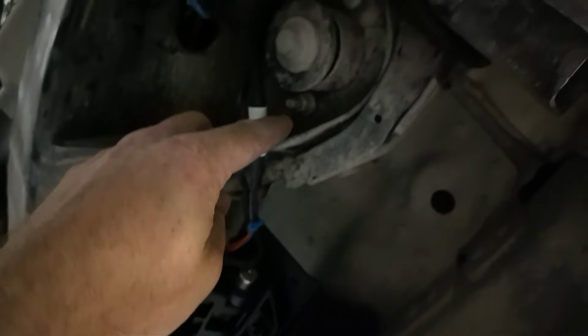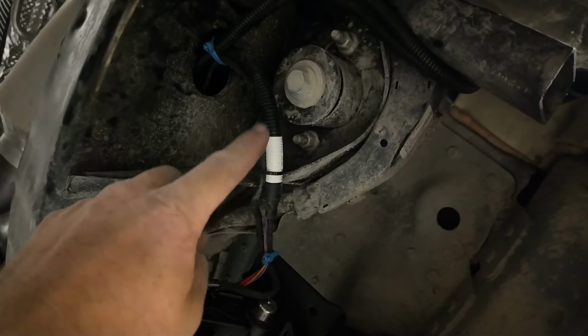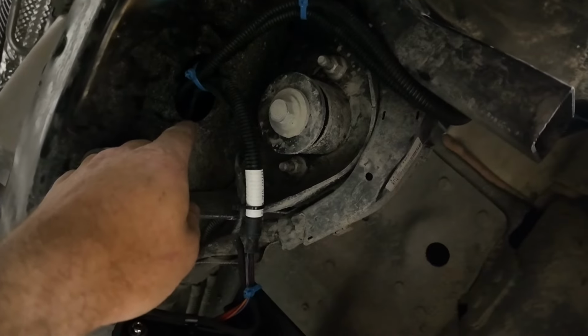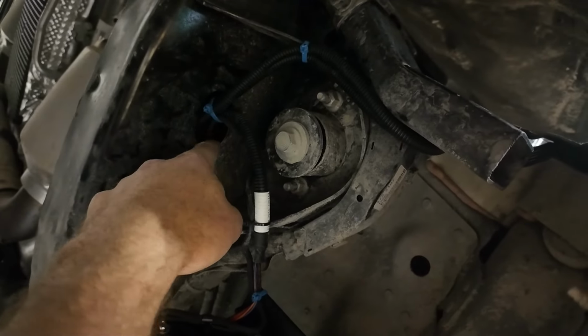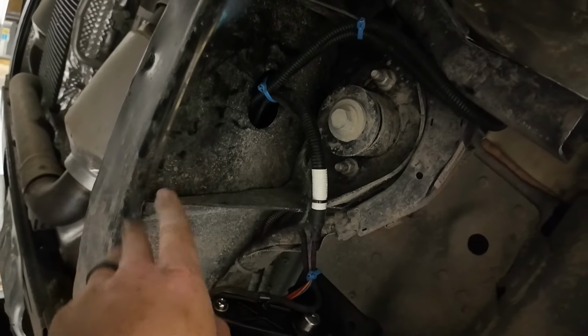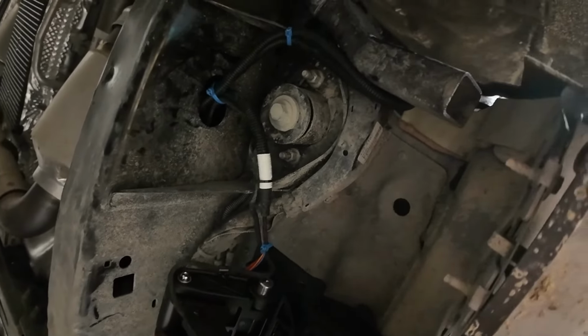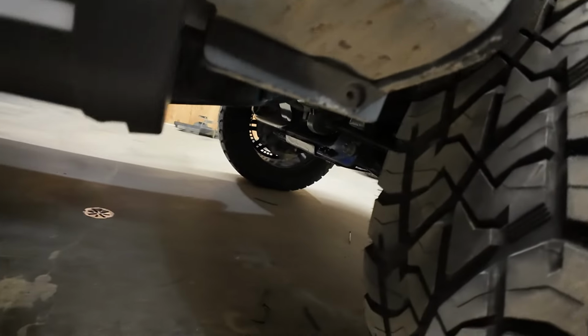Coming underneath here, I'm running up here. And then I have my wires coming from my engine bay here and my wires coming from my lights and my motor here. I have everything nicely tie wrapped, and I shoved everything into the C channel, into the frame. I shoved it all in there and tie wrapped it all. At least it'll stay somewhat protected in there and keeps the bird's nest out of the way and cleans everything up very nicely. It is out in the elements, I guess, to a point, but it's nice, clean, and tidy in there.